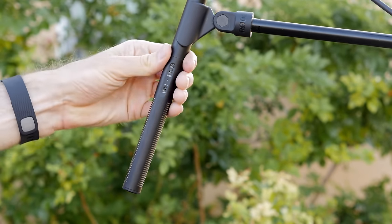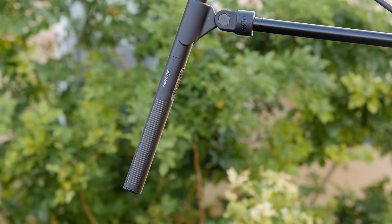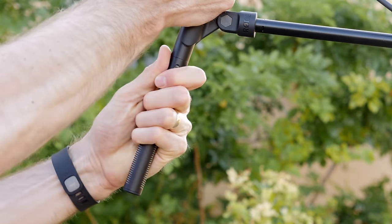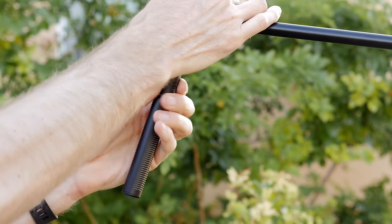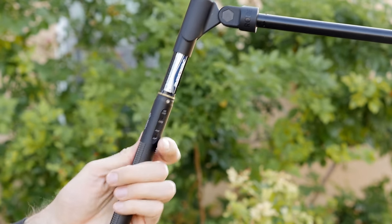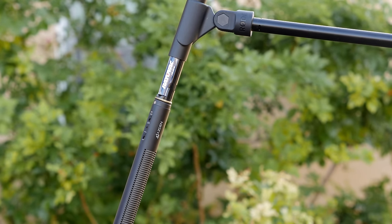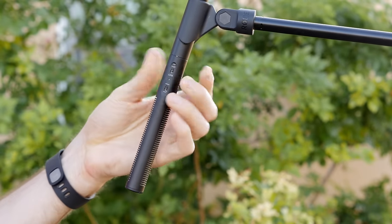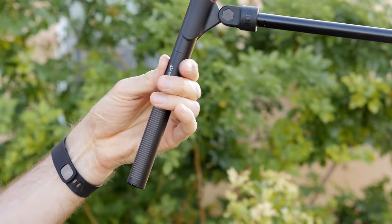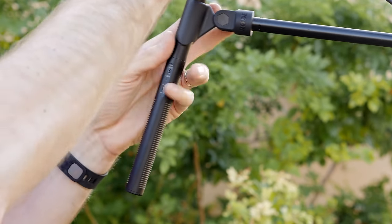The switches are very nice on this — very small and stay out of the way, but large enough to easily operate with your hands. You don't need any special tools, and they are not easy to accidentally bump to a different position, which is a really nice feature. The battery is accessed by unscrewing the bottom of the mic, and it slides open. One single AA battery is what it takes. There is a power switch — leave it off if you're phantom powering from your recorder, or turn it on if you're battery powering. There is also a high-pass filter switch, which is useful for eliminating low frequency sounds like wind, air conditioning, or traffic. You do sacrifice some of the bass response of your talent who's speaking, but it does get rid of some of that noise.